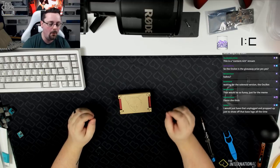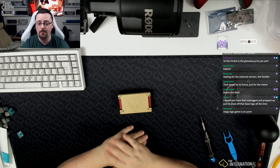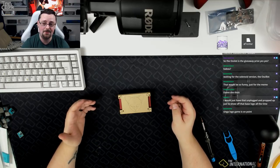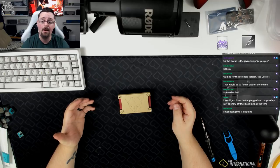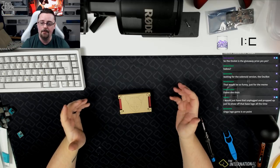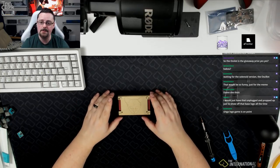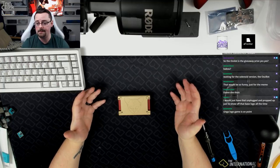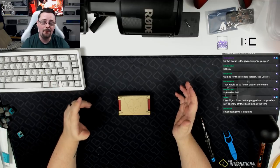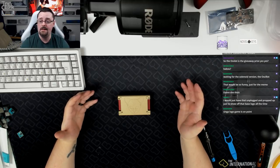TruthGo24 says, what's your favourite switch of all time? So I really love buckling springboards. I don't even have one anymore, but I do love a good buckling spring. If you want to talk about MX switches, then it's a tie up between Zealio V2s and Holy Pandas, depending on whether I want a loud or a quieter board. My canoe, which is somewhere on the wall, is built with Holy Pandas, and I've got a couple of other boards built with them as well. I absolutely love those switches. But in terms of day-to-day usage, I think Zealio V2 is probably better for office environments. If I'm going to go linear, then I like to use Tangerine switches, which are what I've got in this board, only because I like the colour of them, and they're just a standard stock Gateron linear, basically. But once lubed, I think they're just as good as any other linear.